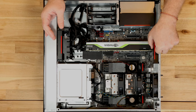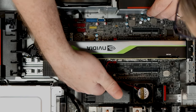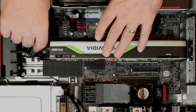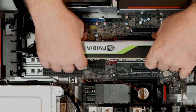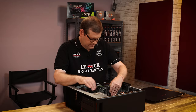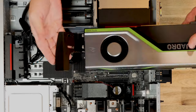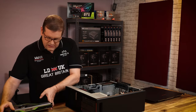It does come with a bit of a tool-less design. To remove the card, there are these little red tabs — you need to pull that tab up and away from the card to unlock it and then pull the card out. It also has a bracket in the back with a little lever that opens it up so we can slide that bracket out. This card has one 6-pin and one 8-pin connector. An RTX 3000 series card would work much better in this machine — much more powerful.